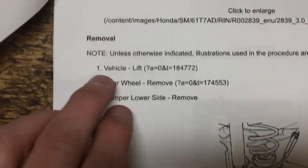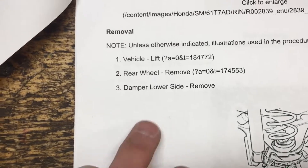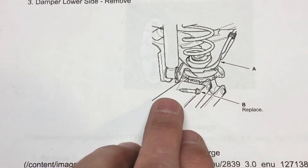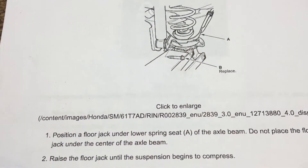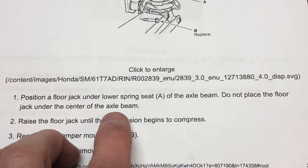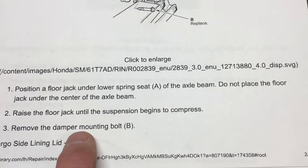So, the manual. Lift the vehicle, remove the rear wheels — go ahead and remove them if you wish. Seems to be plenty of access there with the wheels actually in situ. Lower side of the damper — dealing with this bolt first. I'm just going to go under, clean it up from the corrosion and slack it. It tells you to put the floor jack under the spring saddle to just take the pressure off.